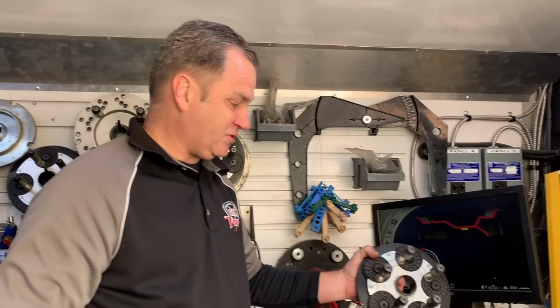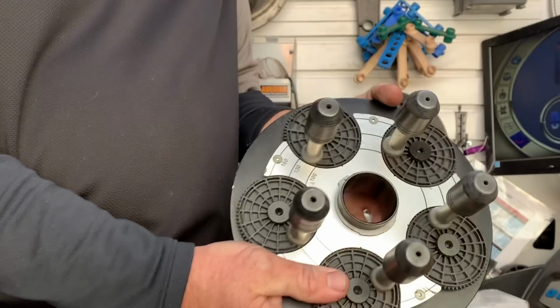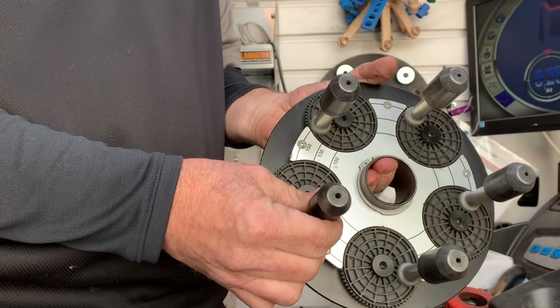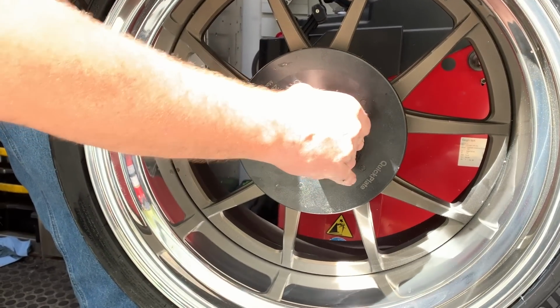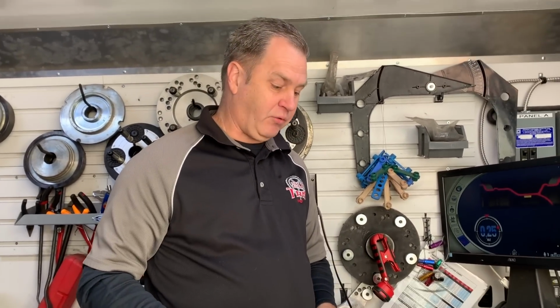And then to hold it from the front side, I'm going to use this adjustable pin plate. Essentially, it can change the bolt pattern to fit the wheel. And once it fits, we just lock down on it. So now you've got hub centric on the inside and lug centric from the outside. It's dead center, and now we haven't introduced another variable into the balance. Like a worn out aluminum cone or something like that. Absolutely. I find that quite a bit.